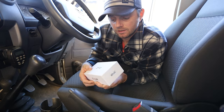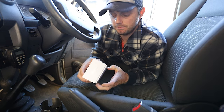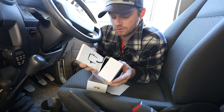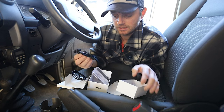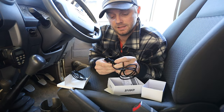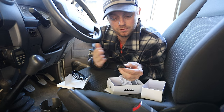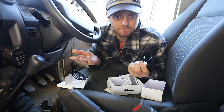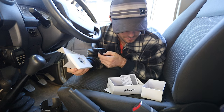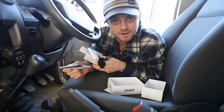So what is an iDrive Throttle Controller? It's a little device that goes onto the pedal relay in your car. Back in the day they used to be cable or hydraulic throttles, but now they've all gone to electric. So what this does is it plugs straight into the plug behind your throttle and then it relays a different signal to your ECU to tell the engine how to rev or open the throttle. It's all the stuff that makes it fun and loud.